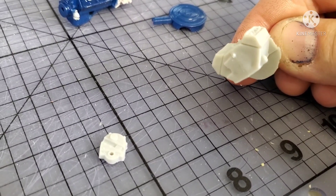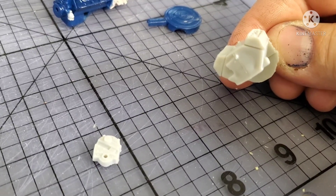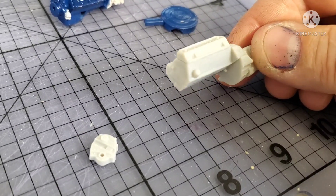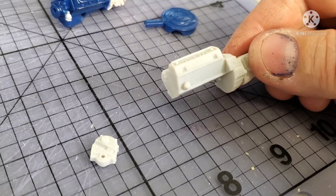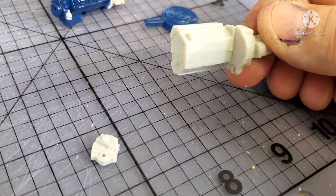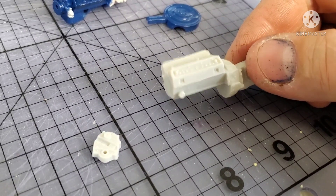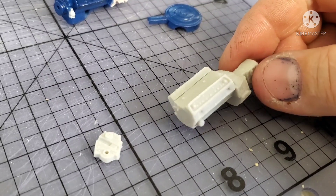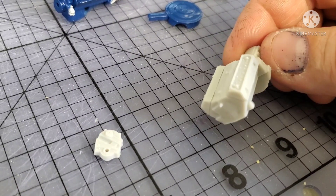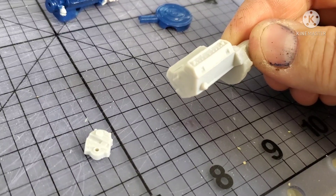You try to get it straight, take a little material off the block and a little off the head to get it to sit even. But you don't want to get it too low and bring the deck heights down, because your exhaust will end up sitting goofy. I've also run a file underneath it just trying to get it to fit half decent. I had way too much time into it - it just isn't going to work.